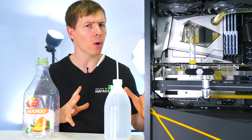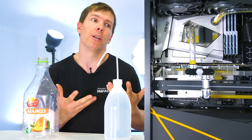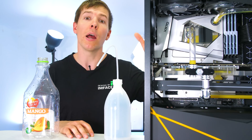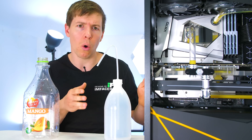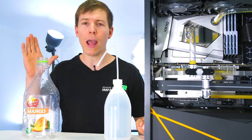We've filled up our fill bottle with distilled water. The reason we need distilled water is because pure tap water actually has lots of minerals in it — you don't want that inside of the system, especially if you're going to be refilling it. You don't want all of those minerals around the loop; it reacts with all the metals, and there's algae or something that starts to grow. So not a good idea to use tap water — distilled or demineralized water is the best option.